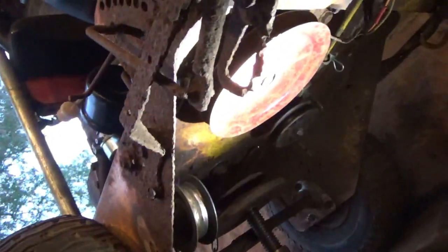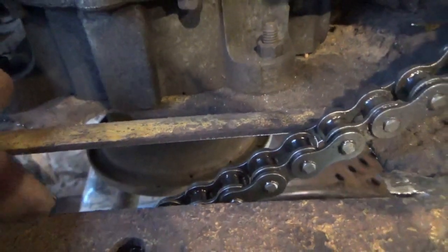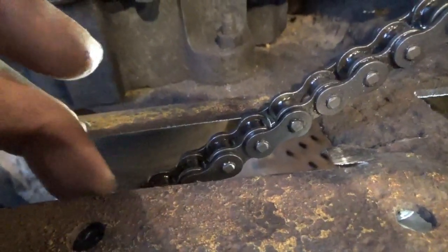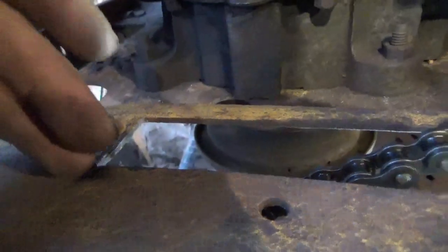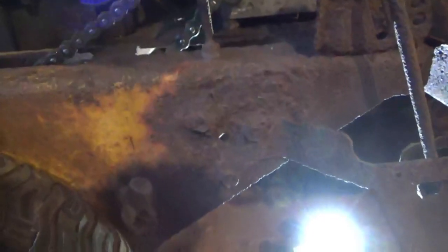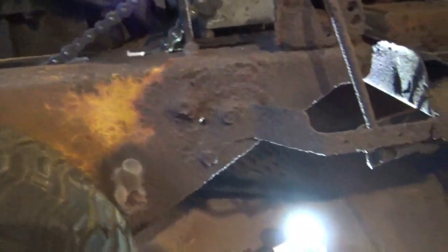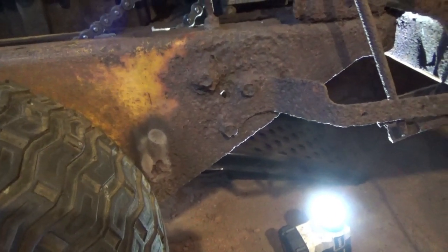The chain tensioner is working great. The only issue was that when I extended the axle I threw the chain just a tad bit off — it was pushing the chain into the side — but I've got that taken care of. I just took a little bit out of the box there, so the chain has free roam now. We're going to go ahead and get the clutch hooked up and get a spring on it. I'm going to try to break that pulley loose on the engine, get it shoved up and matching the others so I can start sizing for the belt.